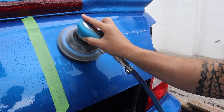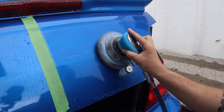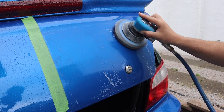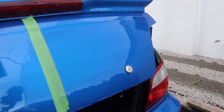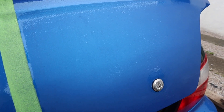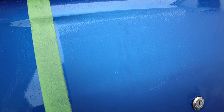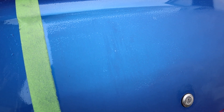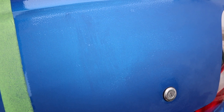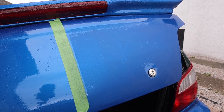Off camera I've done a third pass at 1500 grit, and what you're seeing now is the first pass at 2000 grit. The whole point in moving up the grades of sandpaper is that every time you move up, you knock out the previous sandpaper's sanding marks. I'm now going to start moving up the grits. I'm a bit nervous about doing this to a freshly painted panel - if I really had to I could repaint it, but I'd prefer to get this right on the first go. After the 2000 grit you can still see a few areas that aren't perfect, but it'll be a hell of a lot better. I'll do another go with the 2000 and then a 3000 before starting to polish.